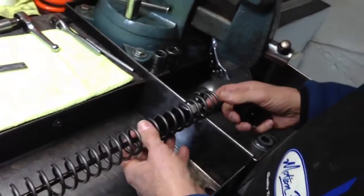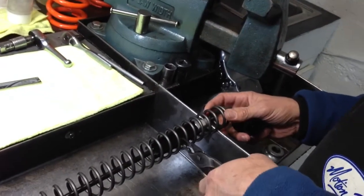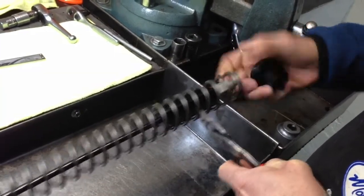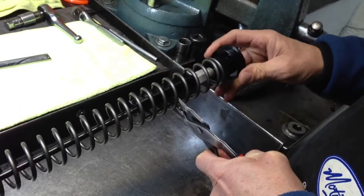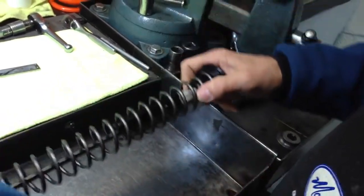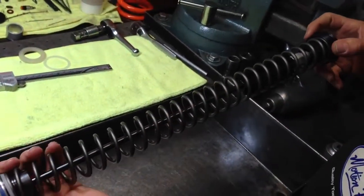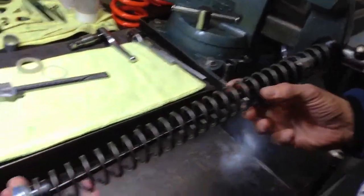The way I'm going to do it here — because this cartridge doesn't have any oil in it — the spindle assembly is going to tend to fall down if I try to slide the spring down. I'm going to grab it with a special pair of pliers, screw the spring down enough to get the cap started, and put it on a couple of turns. At this point the spring is loose on there, so it has a negative preload. I'm going to turn the cap until I get rid of that free play where it's just sitting at zero.